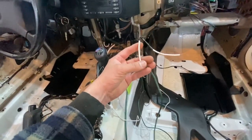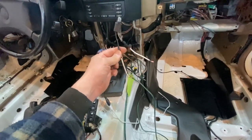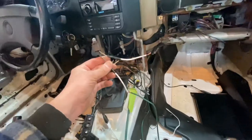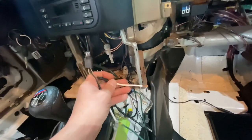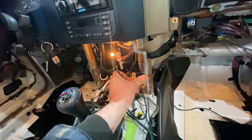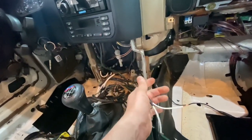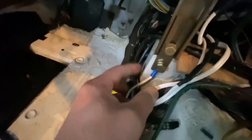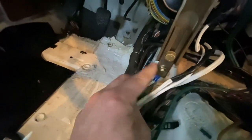The fuse is in — this is positive, she is hooked up. Now to make a light bulb light up we don't need to run a second wire all the way to the battery negative, because the whole car is negative. All we have to do is find a good solid piece of bare metal, touch the bulb there and then to positive, and it lights up. So we can get our negative for our switch right off the car body anywhere there's a bolt.